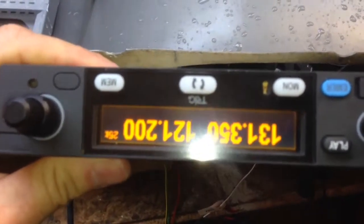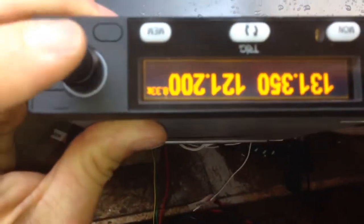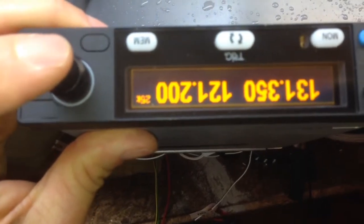I've made all the preparations for the radio and labeled all the wires. It has a new connecting system — this is the back plate of the new Trig. To test everything before I put it back, I made a connection to my 12-volt charger to see if the connections are correct. I can only test the power of course. So here's the new radio — let's see if I can put it on. It's on! Now I put the power on and yes, I made the power connections correctly. It shows 8.33 and 25 kilohertz.